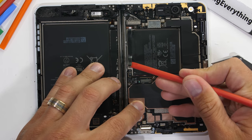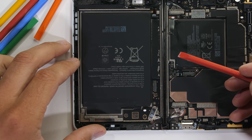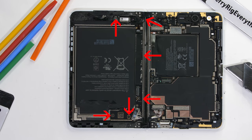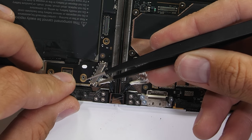I'll unclip the smaller of the two batteries. The larger battery does not have a visible disconnect. It might be underneath the smaller circuit board. I'll remove the 6 T4 screws holding that board down, then I can unclip the very interesting looking wire cable